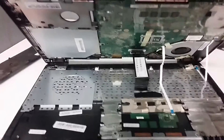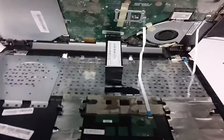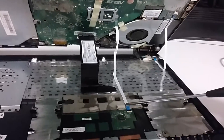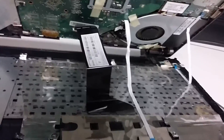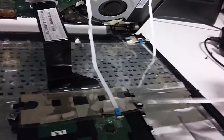There are two little screws right here and right here — you want to make sure you get those out before you start pulling off the back panel. I simply lifted it up like that. You then have some cables that you're going to want to disconnect — there are three cables: one, two, and three. To disconnect them, work on this side only; don't touch the others.